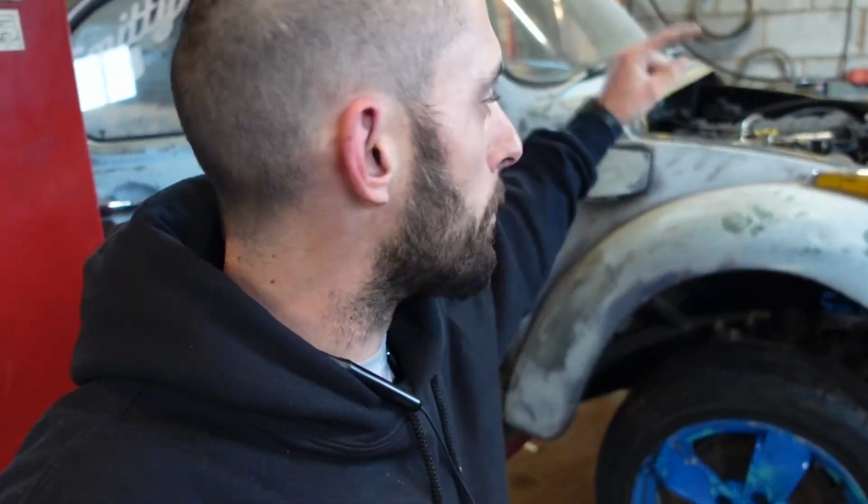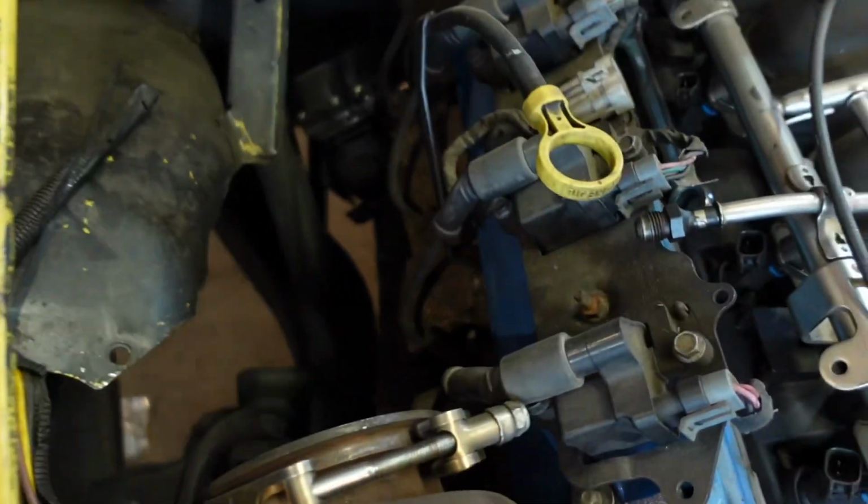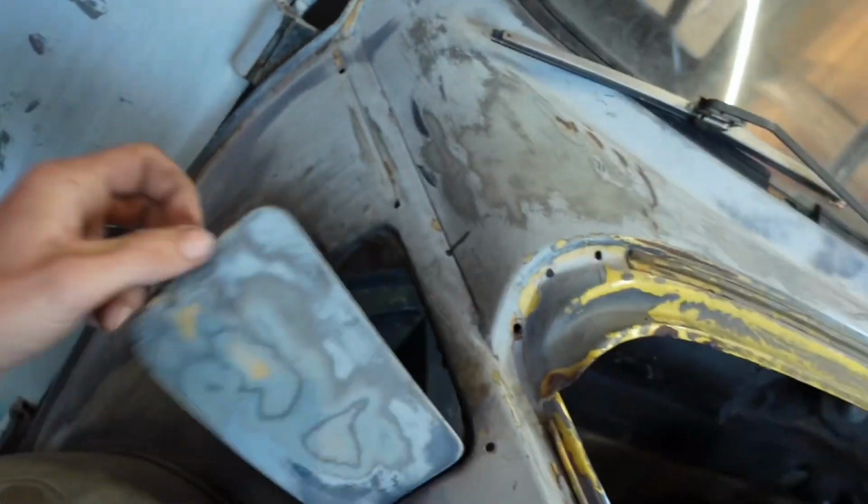We're making good progress. So after that, we're gonna jump on the exhaust crossover that connects both manifolds and goes up to the turbo. We're gonna redo that crossover with some V-bands, get that done quickly. Then we gotta get our exhaust dump, come out the back of the turbo and out the fuel door like we had it last time. We're doing a 4-inch one this time, and we are redoing it because now the body sits different to where it was last time, so the old one won't work.